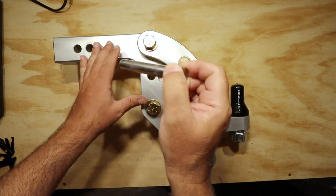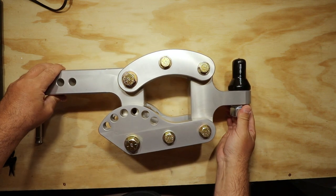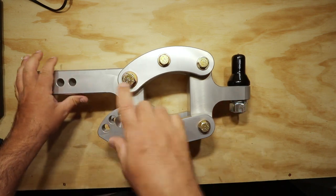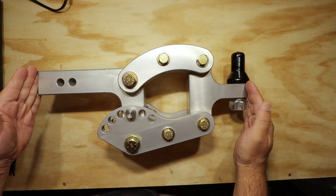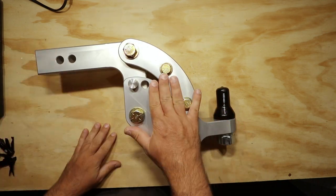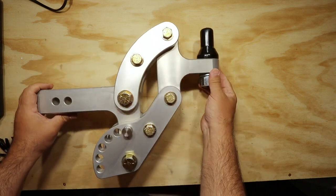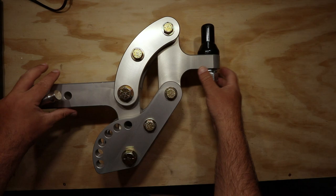For safety reasons, that 1,500 pound tongue weight capacity is measured at its fullest extension. It's not meant to exceed 1,500 pounds, and the most stress on this mechanism is when it's clear out here at a level height — all the way extended. Just by physics, if this is all the way down, there aren't as many forces. All the way up also allows greater forces on your tongue. Again, don't exceed that 1,500 pounds.